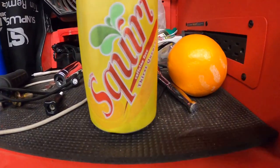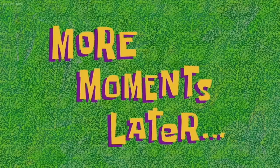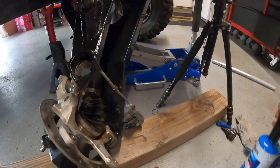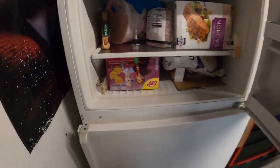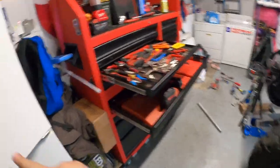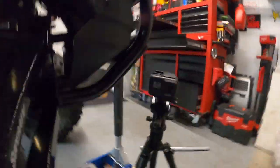What we're doing is expanding the metal on the arm and contracting the metal on the ball joint. After about two minutes of heating, go ahead and grab the ball joint from the freezer — sitting nice next to the fish and frozen waffles. You just need to hurry up, wipe it down with your hand, and shove it in just like that. No press. We have a little bit of a gap, so we'll go ahead and pound it in quickly.